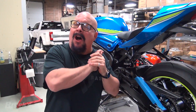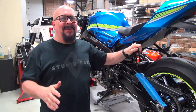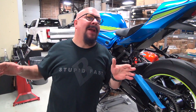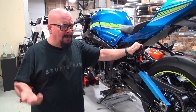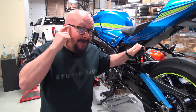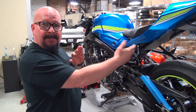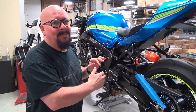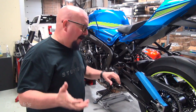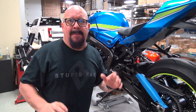I get the question all the time: Brock, how much should I lower my bike? There's a definite answer, but there's a big equation to get to that final answer. What we tell people is, yet again, it's all about safety. Let's use a little common sense here. If we slam our bike on the ground, are we going to have as much cornering clearance? No, we're not. Potholes and speed bumps become our enemy, especially speed bumps because they'll flatten your pipe or tear up the bottom of your bike.